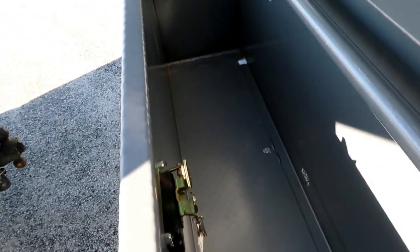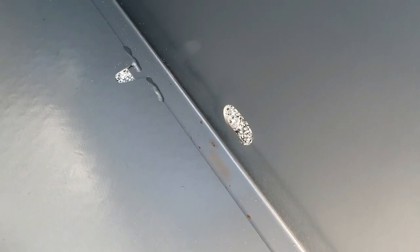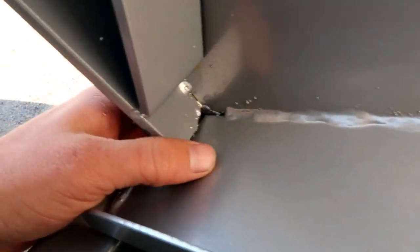Looking at this toolbox again — it's massive all the way across. We do have little holes in the bottom to let water out if any gets in, and there's also a place for cabling to go through, a place for a grommet, if you were to have a battery for a winch or other components. Here's an area I was a little bit disappointed in — when they built this box, this area didn't lay flat and they've got a pretty rough weld. We blew through a weld here — you can see light through there. This whole area looks like there's some contamination in the paint process, not the best coverage, and some rust spots — though a lot of the brown stuff is dirt. This trailer hasn't had really time to rust, but I do foresee some potential for rust in here.